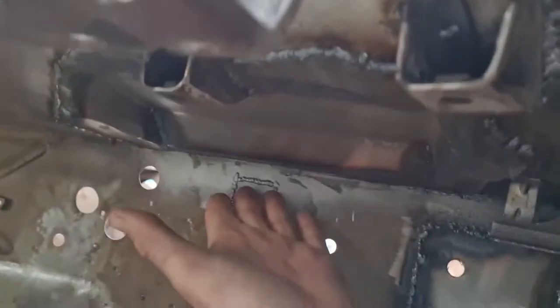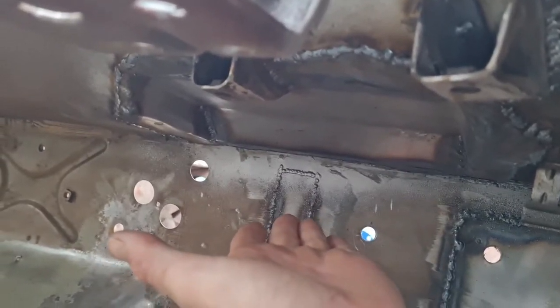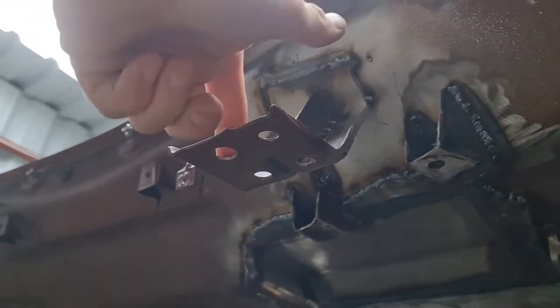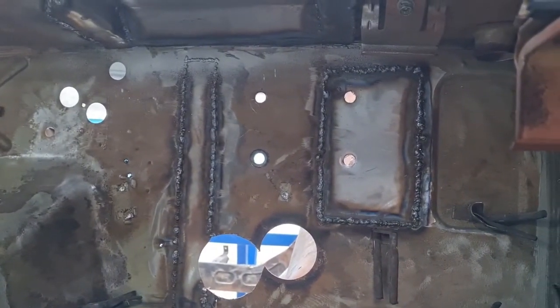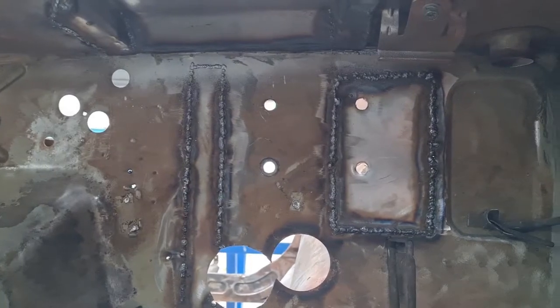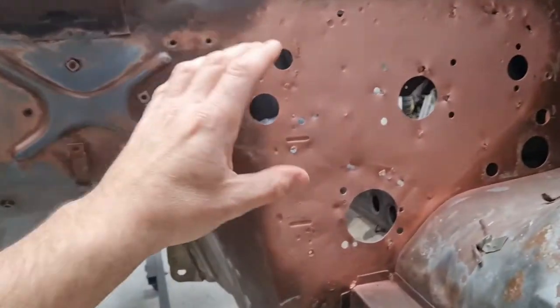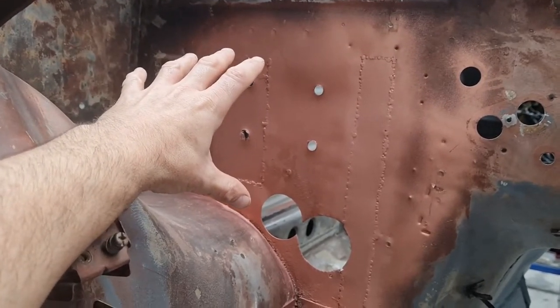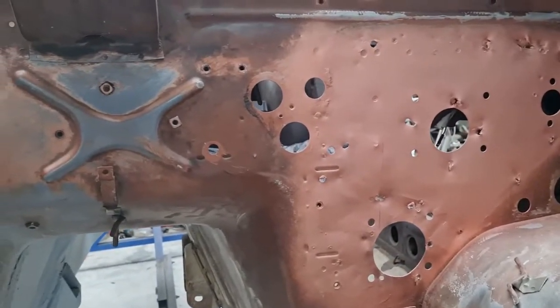The pedal box is touching this plate here so it's up to its maximum position and nice and tight up against these three mounts. You've got 5 bolt points and then down around where the pedal box goes through the brakes — counting up to about 10 or 11 including the clutch plate. What I'm going to do today is finalize this area — essentially plating this off. It's got a nice weld-through primer on it now. I'm going to get the location of the clutch pedal plate tight onto this and finalize all the holes, then get it tacked on. Hopefully by today I'll have the outside of the firewall complete.